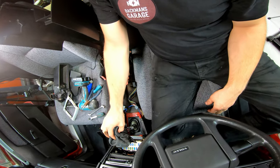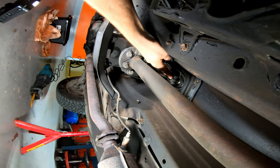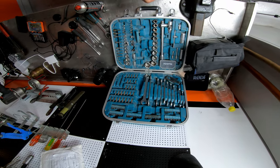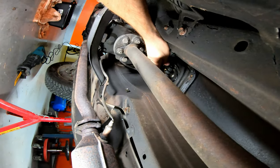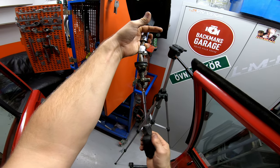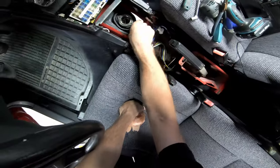We need to remove the shifter from the linkage below, so let's head under the car. We're going to get this screw out right here — this is the only thing holding the shifter on. You remove this, it's a hex bit. And then you remove the spring right here. Probably a number four. You just insert it like that, take it out, then just slide this out. Screw this back — we're not going to be using this, but it's unnecessary to just lose things. So now this is free.